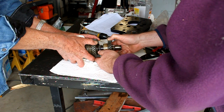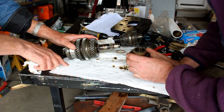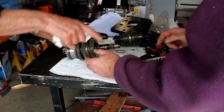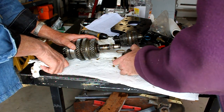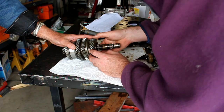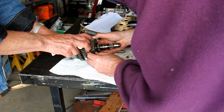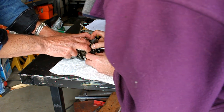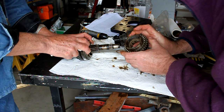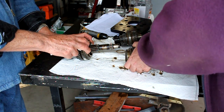Next off comes third gear. Look at that sludge in there. Third gear — the race goes towards the inside. Next up will be second gear. Second gear again, and the race is pointed that way.